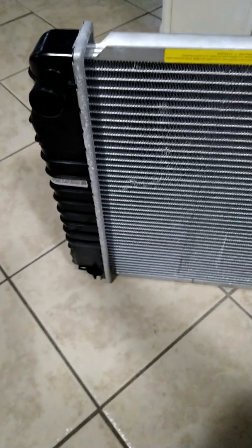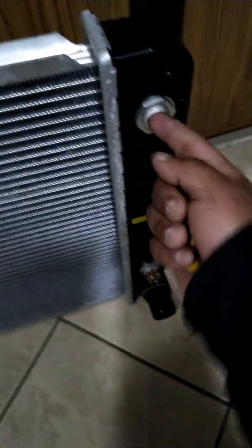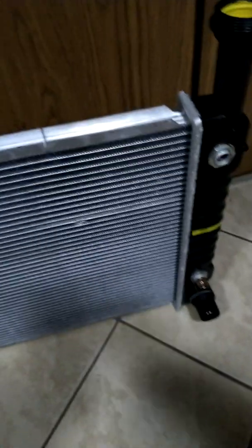Look out for the next video on how to change it. Basically the things you have to look out for are: the top coolant hose, the lower coolant hose, the two coolant pressure lines, and the hose that goes from here to the plastic overflow tank in the engine. This has been a simple overview of a Chevy Express radiator — thank you for watching.